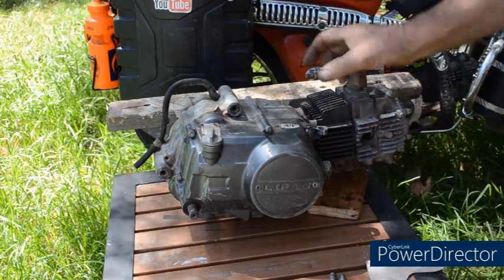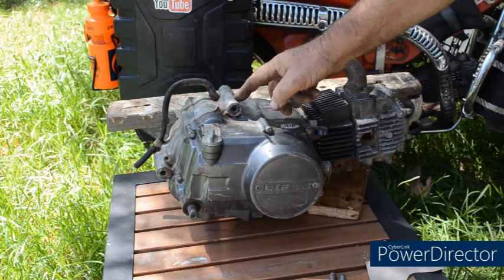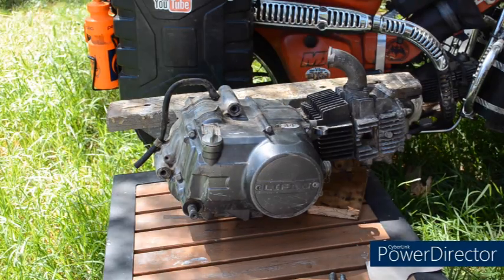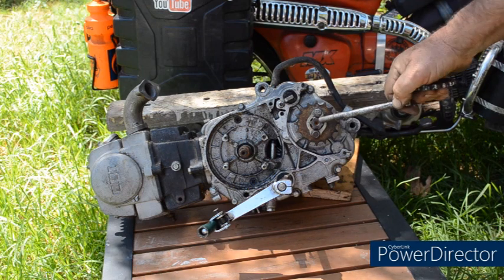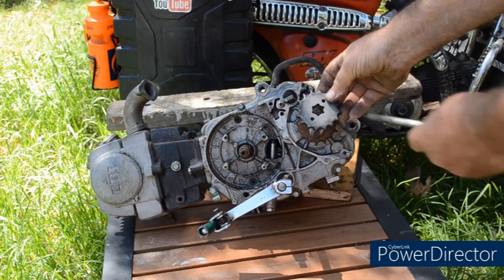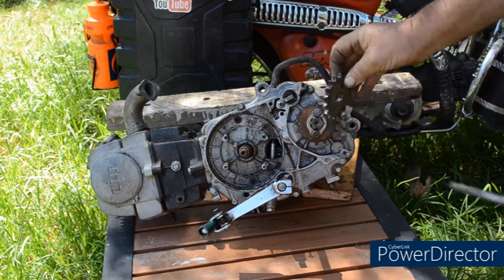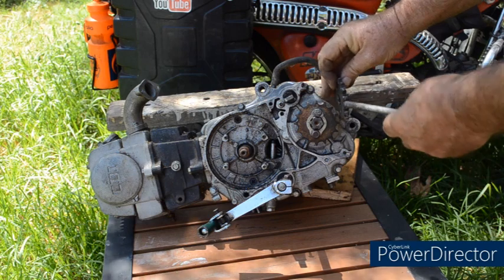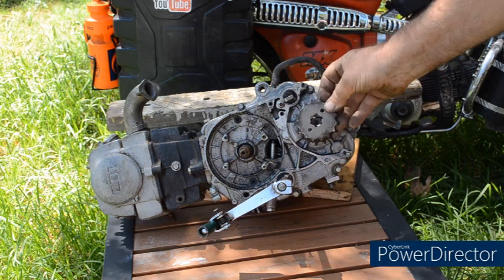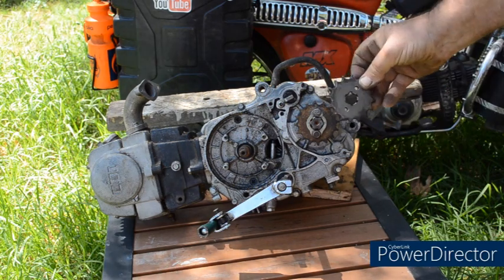Also, the width of the mounts is different — they're narrower and subtly different on the Li-Fan, so you'll need to move the engine across to accommodate for that. And the sprockets are different. On the Li-Fan the shaft is 17mm, and on the CT110 it's 16mm. The difference is the depth of the splines. Also, the CT110 sprocket is quite a lot wider than the Li-Fan sprocket, so you can't fit the CT110 sprocket on there unless you grind out the inside of the sprocket to make it fit.